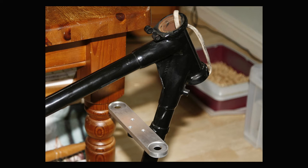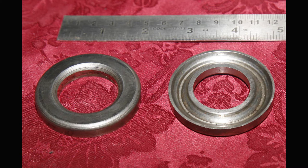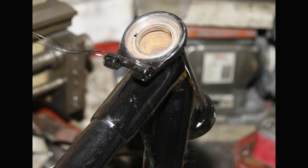They'd only been sat in the workshop for a few years, but at this point I'd cleaned them out - I used a wire brush for getting the worst of the rust. I'd also removed the paint from around the top edge with a scalpel. Although that may seem quite insignificant, it's quite important because you want the head racers, when they go back in, to go in as flat as possible. At the bottom of the machined area, there's actually a groove all the way around, and on the left there's a hole - that's a greasing point. On Norton frames, both top and bottom there are grease nipples to allow greasing into the ball racers for the head racers.